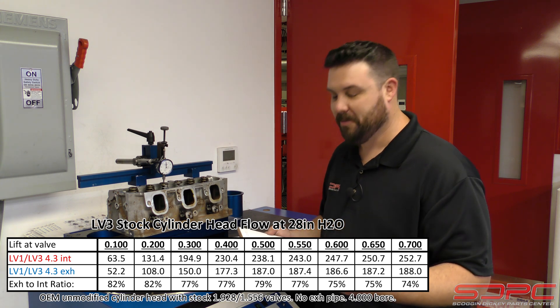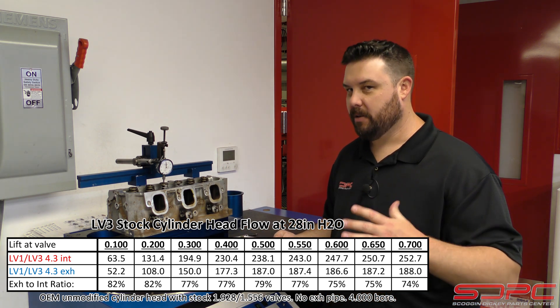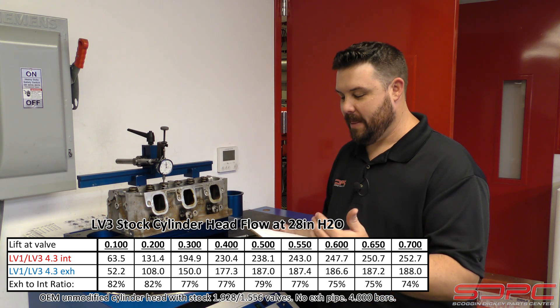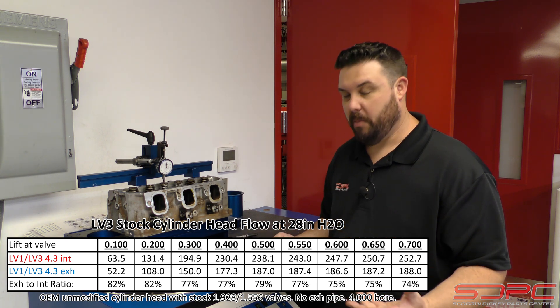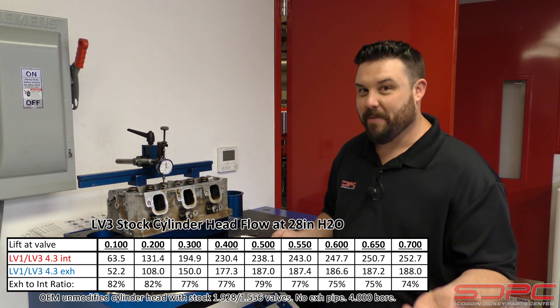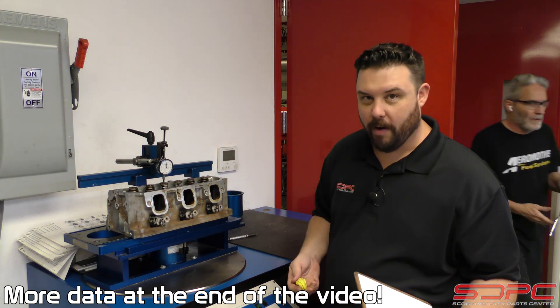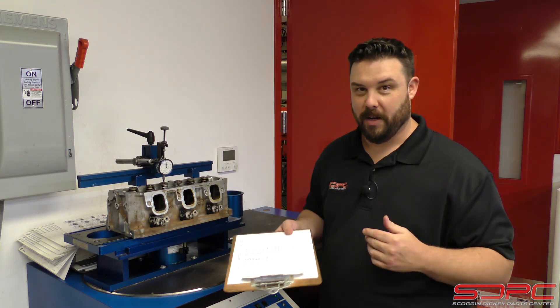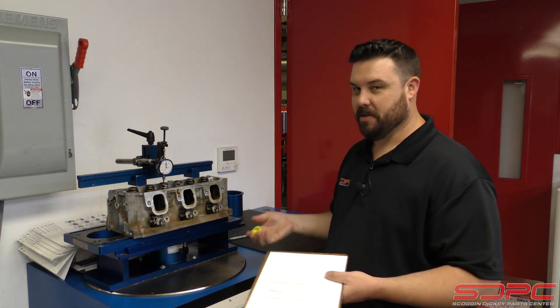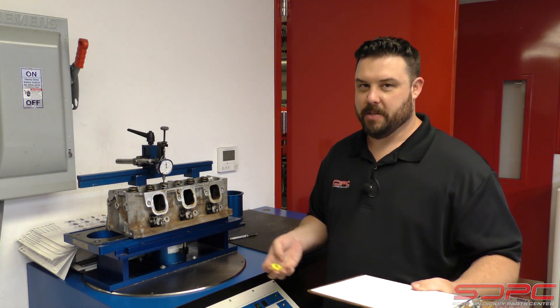The exhaust actually peaks right at .700 lift, but there's a whole lot more to this story. The actual flow numbers grow really well up until about the .400 lift range, which sounds low. Then when you get into .500, it's a very small gain. And after that, on both intake and exhaust, it's actually a creep — a couple CFM at most. The actual exhaust was anywhere between 187 to 188 CFM from .500 to .700 lift. Y'all are not going to be running that. Our cams are in the 500s, kind of the low 500s, to keep you guys using a nice cheap spring. And this actually helps us — one of the reasons we're doing this is because we're thinking about making a third stage to our camshaft, something really big for these guys. We needed to know where this really matters, and obviously the low lift is where it's going to be at. So a good low lift profile is going to help more than max lift with a big expensive valve spring kit.